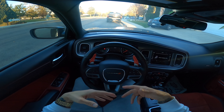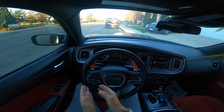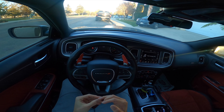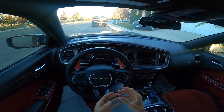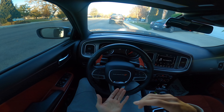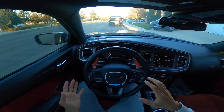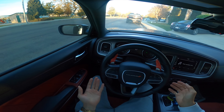What that's gonna do is allow some oil to get on that cam, because between 1500 and 2000 RPMs is when the cam gets the most lubrication. The defect in these Hemi engines doesn't allow that cam to get lubrication when you're below that threshold. When you're below 1500 RPMs that cam is not getting lubricated, and that's how the lifters give out — the rollers get stuck and they start banging away on that cam. That's when the real Hemi tick starts, the cam gets depleted, metal gets thrown around the whole engine, and you're pretty much screwed. All Hemis have the Hemi tick whether you hear it at first or not — it's just the defect in these Hemi engines.